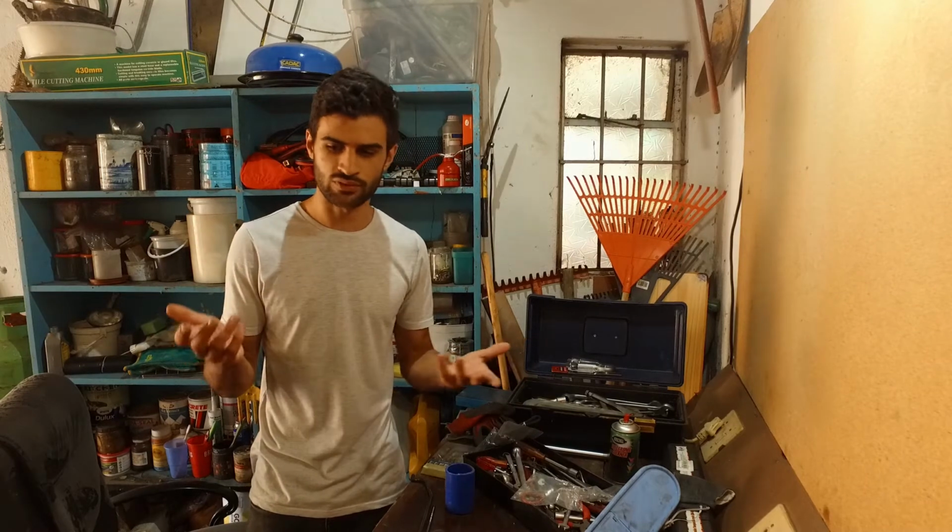From where the flange connects to the downpipe itself, the mounting holes are actually off. I'm assuming this has to do with the fact that we have the T25G turbo instead of the T25, and this downpipe was fitted on a T25. So I'm just assuming that's what's happening.